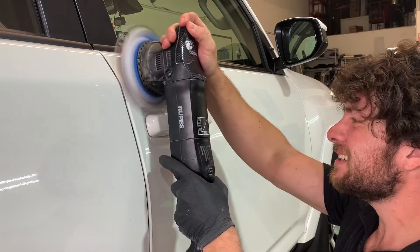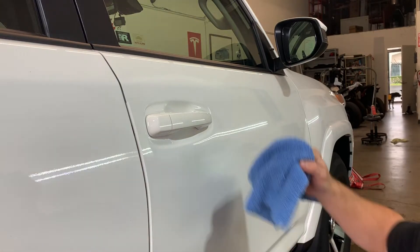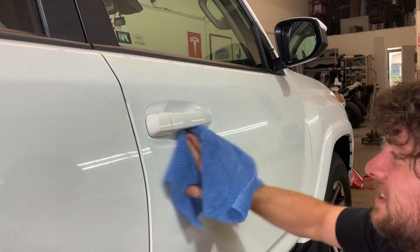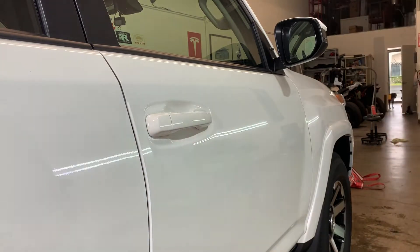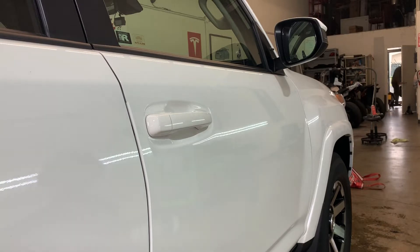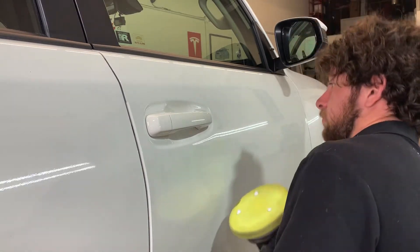Just make sure you keep that pad spinning. Something like this can really make a car look that much cleaner when you deliver it to the customer, especially because on a lot of cases, whatever side of the car the sun is on, you'll get some reflection off of the door handle area. Everybody notices all the scratches in the actual door cup — you can see the swirls and defects around the actual handle if you don't get around it.